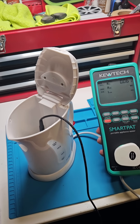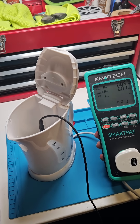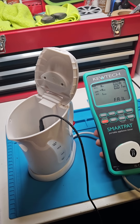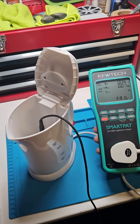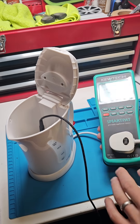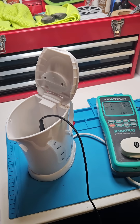Now we're looking at the insulation resistance test. It has to be a minimum of one megaohm, and you can see it is 0.01 — so there's literally no resistance on that test. Check out my YouTube for more, but that is a massive fail, and because of that failure, whenever this kettle was being turned on in this accommodation block, it was taking down all the power.